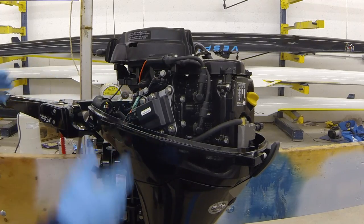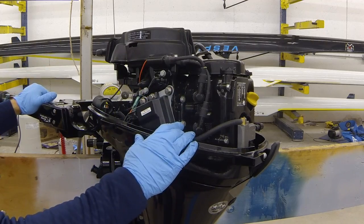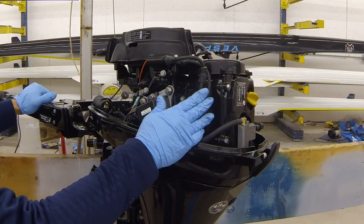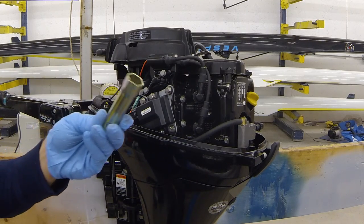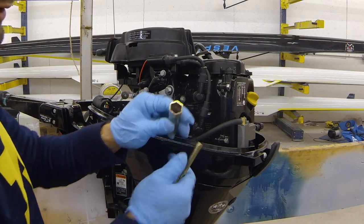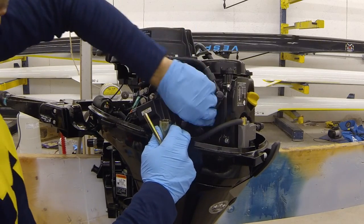But all too often, rowers are carrying it or something and it's carried on the wrong side, or it's left lying on the wrong side and oil gets into the cylinders as well as the intake manifold. So we'll go ahead and look at what to do to at least clear out your cylinders and your spark plugs. We'll take the spark plug socket that came with the motor in the spare parts kit. It's really the only one that's going to be able to fit in there because it has such a thin wall in such a tight spot here. So we're just going to go ahead and remove our spark plug